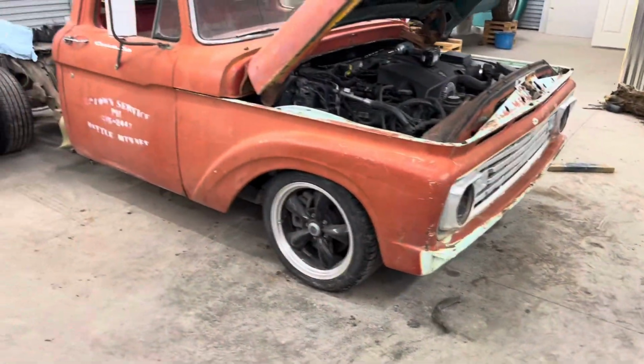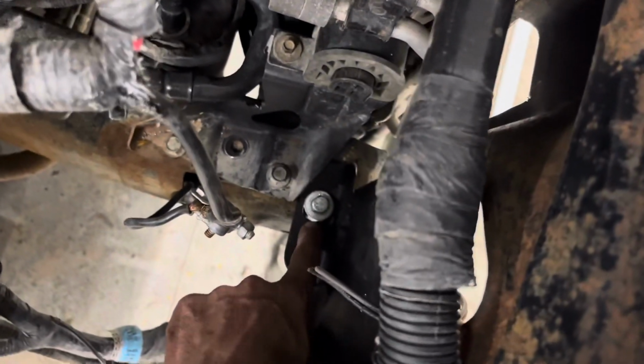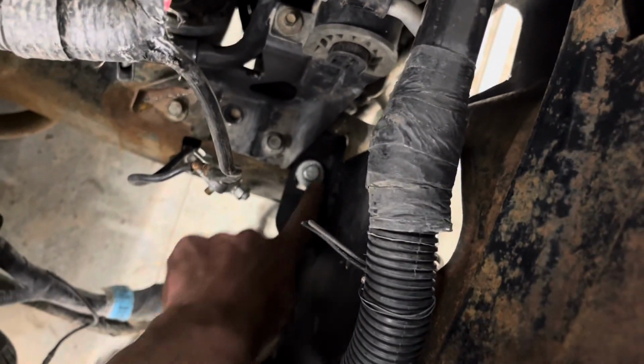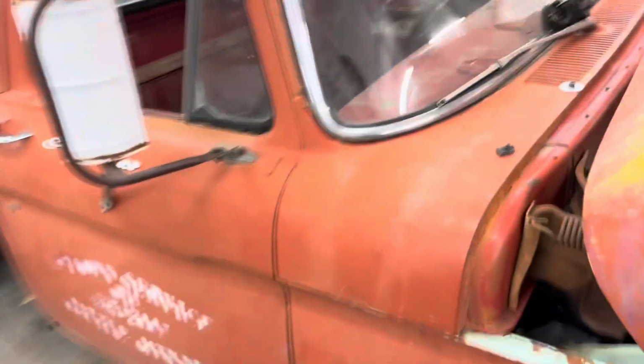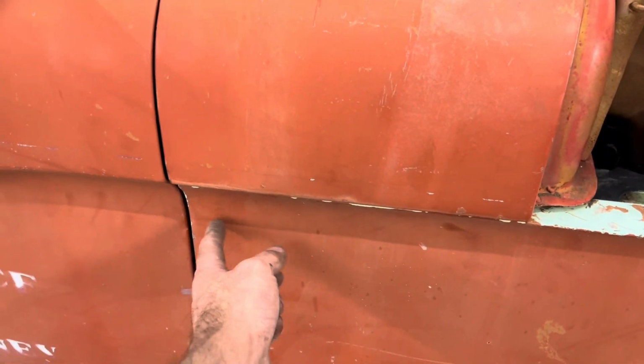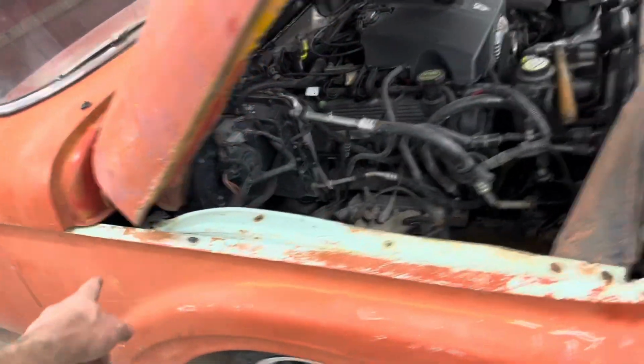Voila! Well, we had a couple little small problems, not a big deal. My adjuster slot that I have right here in this piece of angle iron for adjusting the front clip back and forth, I measured just like this much off. So we fixed that. The nut cert, or the nut clip that was right here to hold the front fender on there, was stripped, but we had another one, so I got that done.